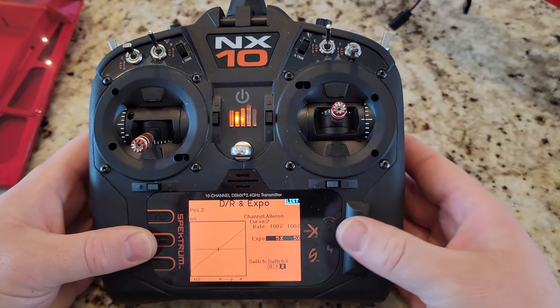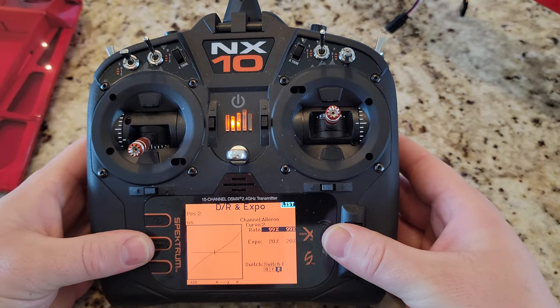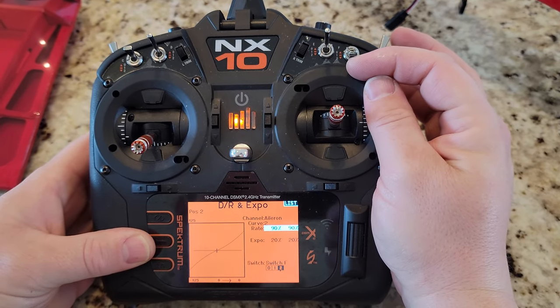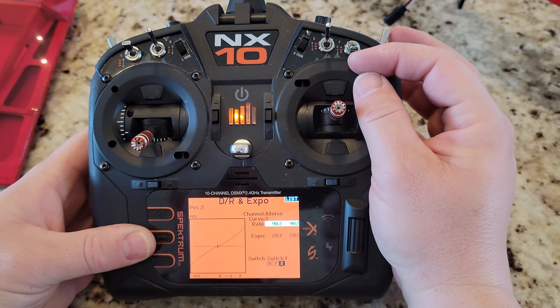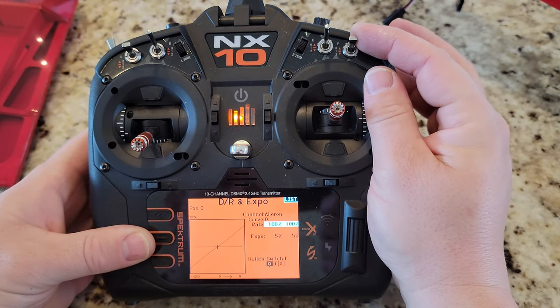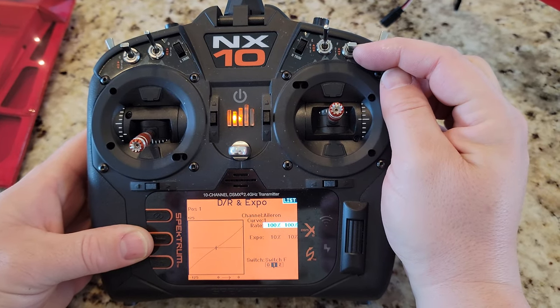Now, if you've only got a two position switch, it sort of undermines my principle of doing the middle, because you start here, and if you need more, you go to that, and it softens the stick and reduces the overall output, so it makes everything very soft. Or you can go here, and it gives you a little bit less expo, so it makes it more touchy, okay? So the idea is to get back to the ground on a maiden, okay?